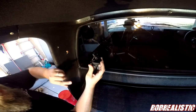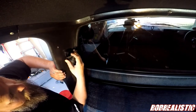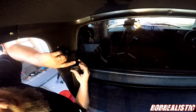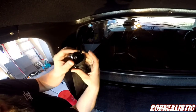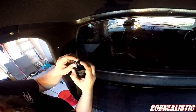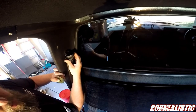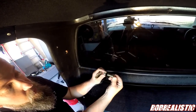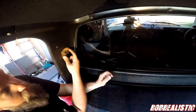If you did not have this plastic piece, you could just bolt this right onto the metal and it would still swivel fine. But because I have this plastic piece, this bolt is too short — if I tighten it, it sits right against the plastic and won't swivel. So we're going to use a supplied bolt with a washer and spacer to bring it back out from the plastic, using this big washer and collar. I went ahead and painted the washer to match — it's going to look much better against the black trim.